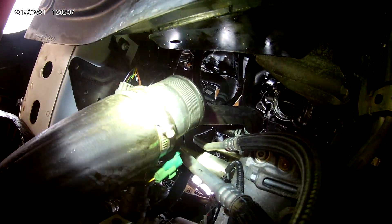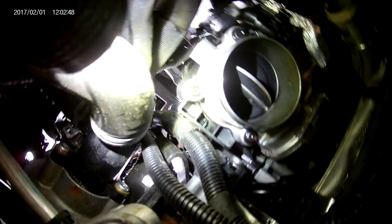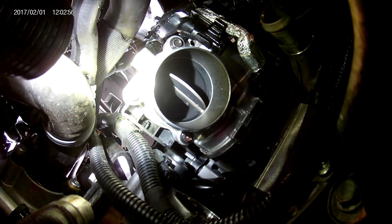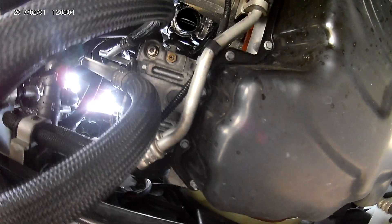That's on the passenger side. Moving over to the driver's side — I've actually got this section apart. It's also pieced together, with the sensor and then into the cooler. What I really want to show you is the inside of the intake. I don't know how well you can see that — it's dark out here — but we've already got soot and carbon buildup. At 31,000 miles we're already getting a fair amount of buildup, and that's going to be a problem later down the road.